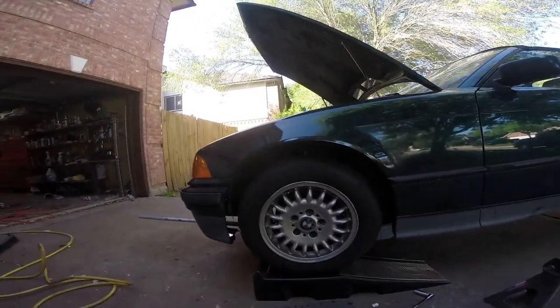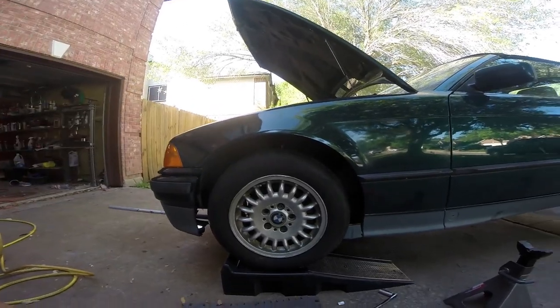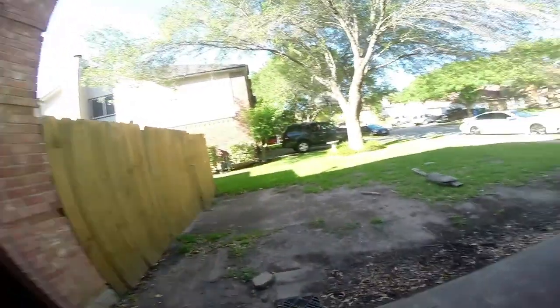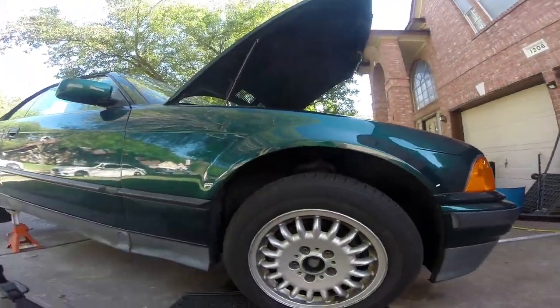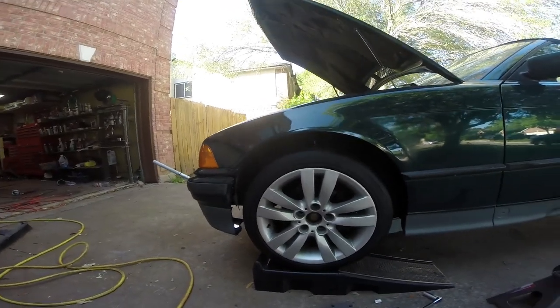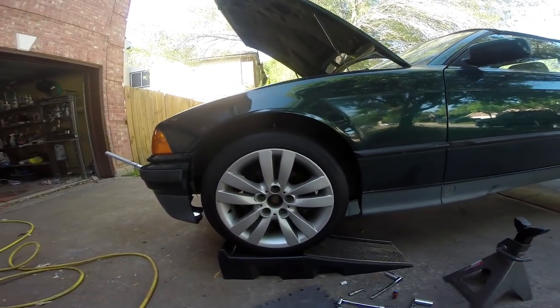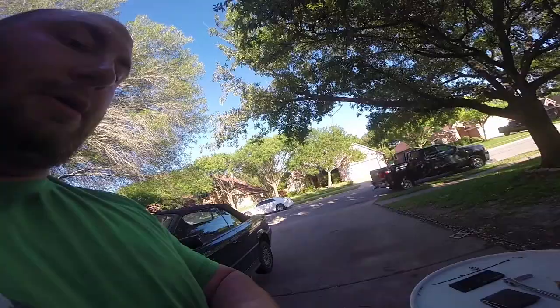It's all in and fully adjusted. Just as an example, I put the wheel back on and set the car down. The gap on this side is about two inches, and the unaltered side has a gap of about three to three and a half inches — I measured it with a tape measure. With the new wheel on, my opinion is there's still way too much gap and I need to lower this thing a little bit more.